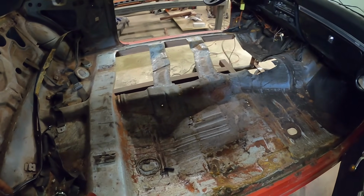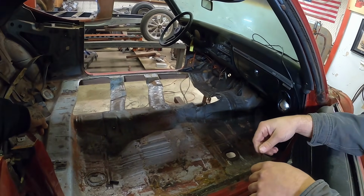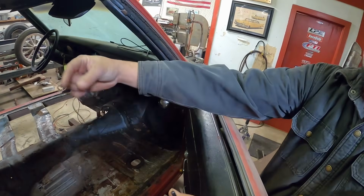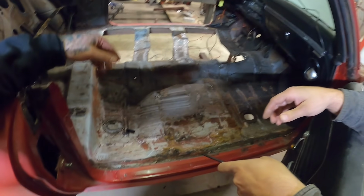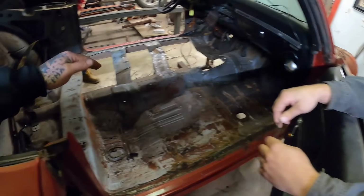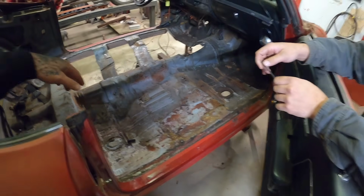Floor be gone. I told you this thing had about 1,000 cross members. It's only got like 2, it's not bad. You ain't got to do this part? No. Just air forward? I'm gonna seam it wherever the edge is on the flange where it goes across. I'm gonna seam it across that and just weld all the way down. So it looks like factory, because there's no seam there. Like on that wagon, they had a seam right there. Yeah, the seam on it was just for overlapping. You just plop it and weld it.